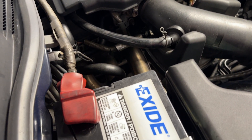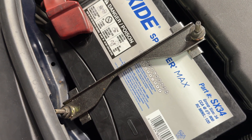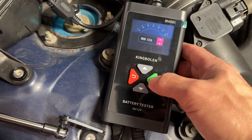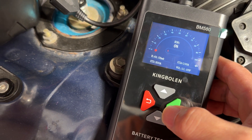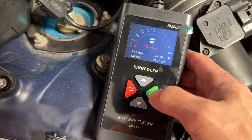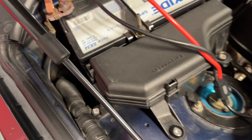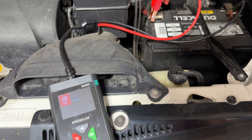This is a flooded battery rated at 800 cold cranking amps, so we set it up to that. As you can see, even after just a year of putting it in, it's way below and needs replacement — we can't reach our cold cranking amps and voltage is really low, even though I just charged this thing a few days ago. That's a big issue — it's just draining.